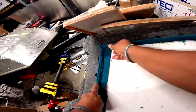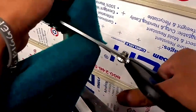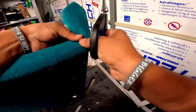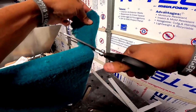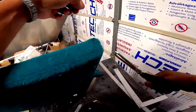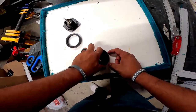I also used a regular utility knife to cut the inside of the excess carpet off. And once it was flush like this, some people just cut a 90-degree angle at each end and then seam them together like that — we actually show you how to do that later on just for variation. But this is how I usually cut the ends of my carpet. The only thing left on this hatch is just to install the latch, which fits in seamlessly because it was already pre-cut for that exact latch.